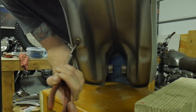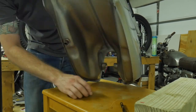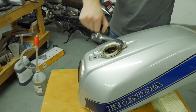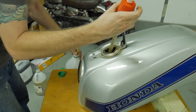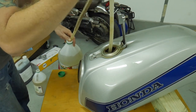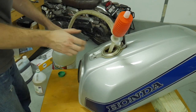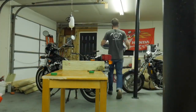This is me just trying to grab that fuel filter out of there. You can work the ends left and right and eventually just yank it all out. But there were some bits in that tank for sure because that fuel filter was not clean. You can see the debris that I'm pulling out — there's tons of it. Using that hand tool is really helpful for bringing out that big material.